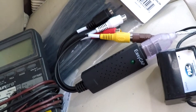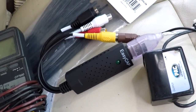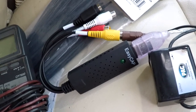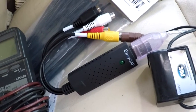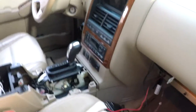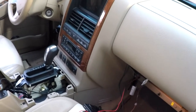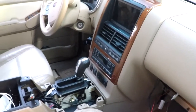The problem with that is every time you plug it into the hub it tries to auto-open the app that's on the tablet. Furthermore, every time you wake the tablet from sleep it wants to start the app. So you turn the car on, you get your beautiful home screen, and then it immediately pops up and says 'no signal' — fuzzy screen, no signal — because you're not in reverse and the camera's not on. Then it goes away and says 'signal lost.' That's the opposite of what I want.